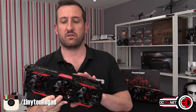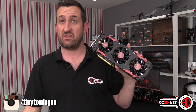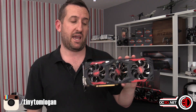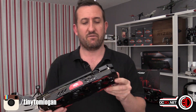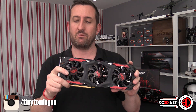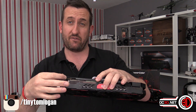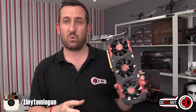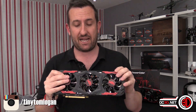So it only dropped by 20 megahertz from the 1320 base. With some old 480s at 1300, I wouldn't have blinked if the average came back at 1200 or even 1150 depending on the power target. I didn't bother trying to overclock it because of the silicon lottery. There is a silent mode — flick that and the core clock drops a little, letting the card run a bit warmer but staying very quiet. Honestly, I don't think you need it because it wasn't very loud at all.